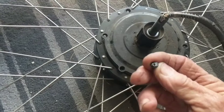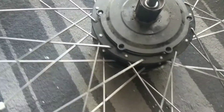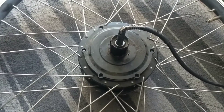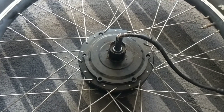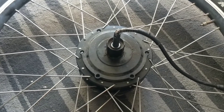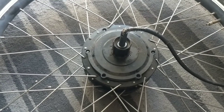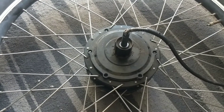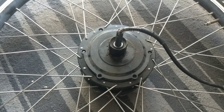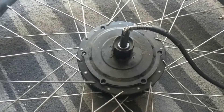Then you've got the screws to deal with. They're fairly tiny screws that go in here and hold the motor in place. They were too tight and they will strip easily. Now if they do strip, you can always drill a screw out — drill down through the screw so the head falls off the body of the screw. Once you drill the head off and get all the screws out, you can remove the remaining part of the screw with a pair of pliers or vice grips.